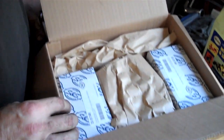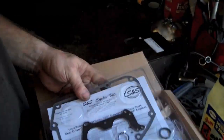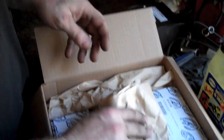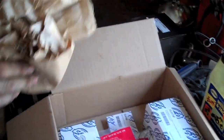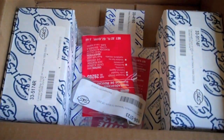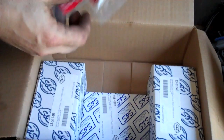We got this cam set, gear driven cam set, came in this morning. First thing I do is open up this package, take out these four bearings and throw them in the freezer. That way they get small and we can put them in there nice — don't have to push any material or do all this stuff.